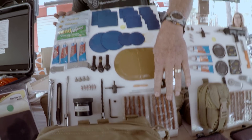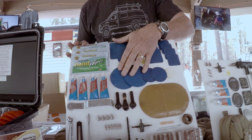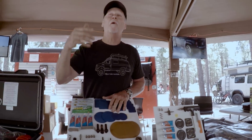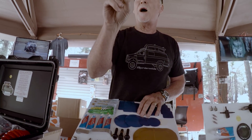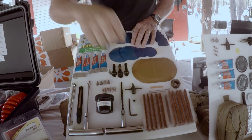These plugs will allow you to fix a puncture on your tire while it's still on the vehicle, and there are tire patches if you have to take the tire off and actually patch it. Say you got a nail, cactus thorn, or a hole from a sharp rock — you ream it out with the auger tool, put the plug in the middle, push it in and pull it out. There's lube you can put on it to make it easier.